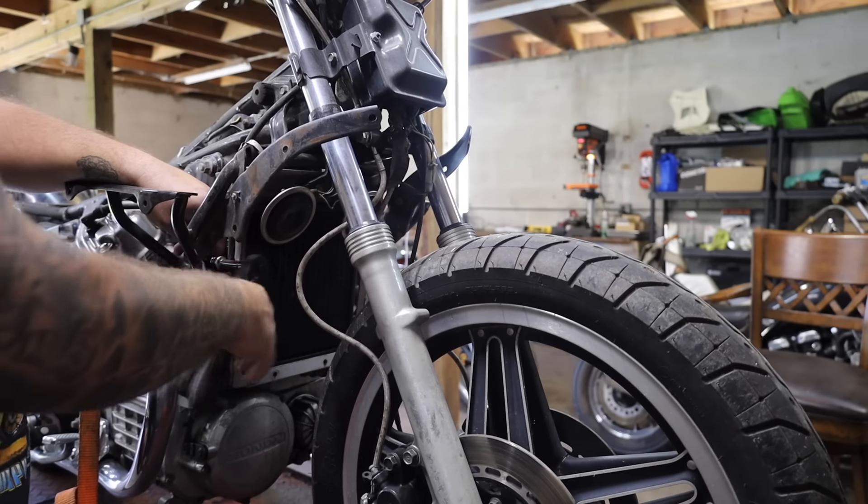What's up, weirdo. Shade Tree Surgeon here, back with the long-suffering Turd Ferguson, the GL500, now completely denuded for the world to see. I already knew I had an issue with the bike — it wasn't charging, it wouldn't start after running for a while, but you could run it on a jump pack. I had my fingers crossed that the stator was still stating and it was just the rectifier. Unfortunately, it's the stator, and that means this engine has to come out.